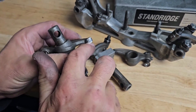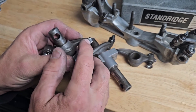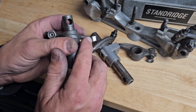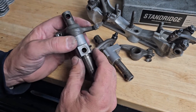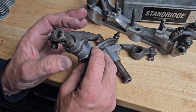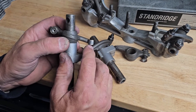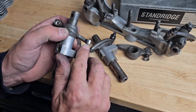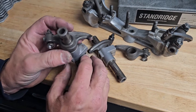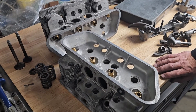The last thing to look at on the rocker is the amount of wear on the rocker pad — the top of the valve has been wearing into this pad. These pads are not that thick; they can be resurfaced, but if you go through the hard facing they have to stellite weld them up to save them again. These are about $250 to $300 a piece brand new and are still available, but they can be rebuilt. This damage doesn't look like it's gone through the hard facing, so I'll let my rocker guy look at it first.